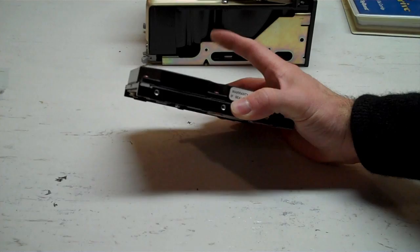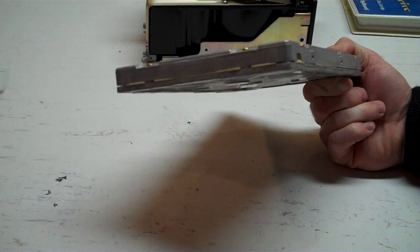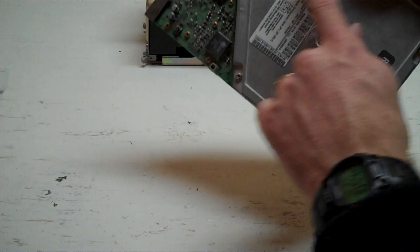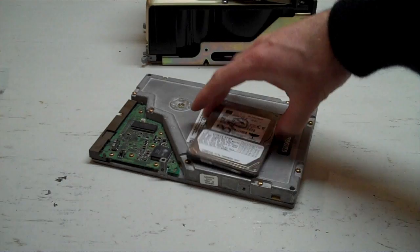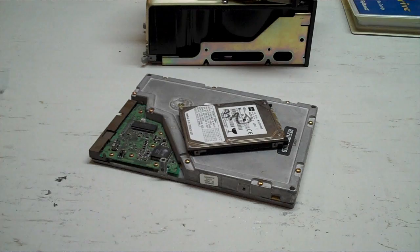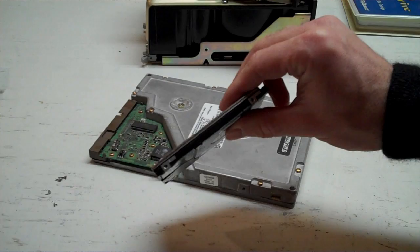As well as standard PC hard disks, we had a bunch of funny formats. We've got the more standard 3½-inch third-height drive, but also oddities like the Quantum Bigfoot. The idea was you would stack two of these in a 5¼-inch internal drive bay. It has a single 5¼-inch platter, and this was a 1.2 gig drive. Then, of course, we went on to the 2½-inch drive, which is everywhere now. It blows my mind that you can pack 700–800 gigs or terabytes onto a drive this size with maybe one or two platters.